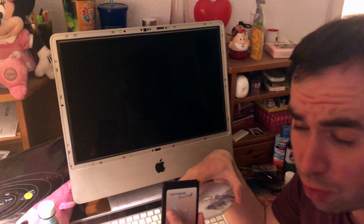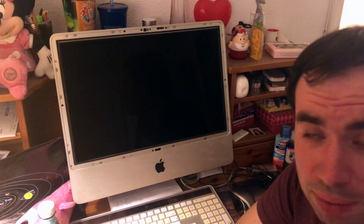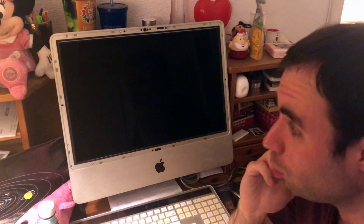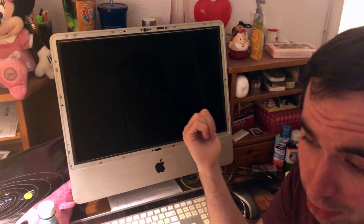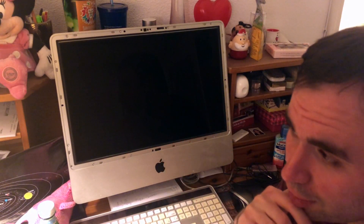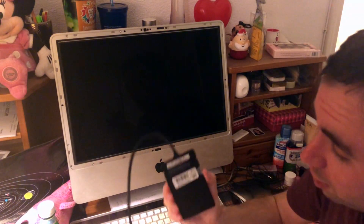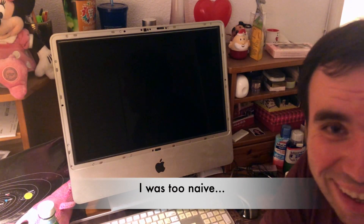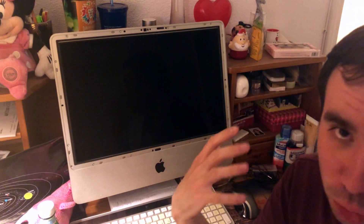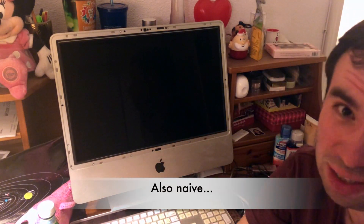I've actually cloned the drive from the iMac to this SSD already using the Snow Leopard DVD disc — it worked, but then the boot didn't work, it was locked for some reason. I tried to clone using the El Capitan thumb drive and it also didn't work. So I thought I'd just plug it inside and see if it works with the SATA cables. In the worst case I'll reinstall the OS on top of the existing one.